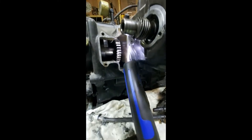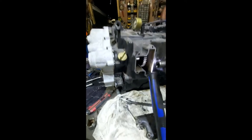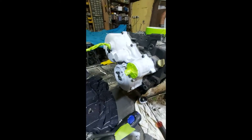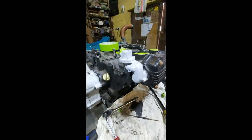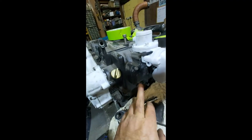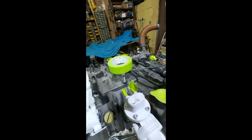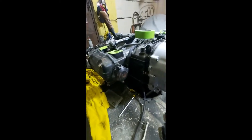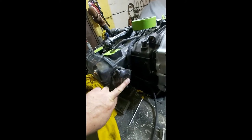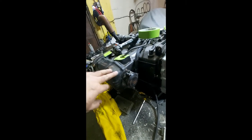What I've got left to do now is put back the fuel pump and put back the inspection cover, and then that's it ready for paint. All the covers are on the engine, everything's torqued in place and all gaskets done. To pull that cover I had to take the fuel pump off, so I cleaned the fuel pump and primed it while it was off. New gaskets have gone in there and in here. Tomorrow I'll clean all the engine down, prime it up, and get a coat of paint on it. The electronic ignition inside looks perfect — spotlessly clean — so I'll keep that and check the box on the other end.